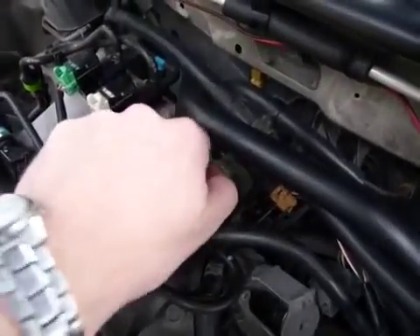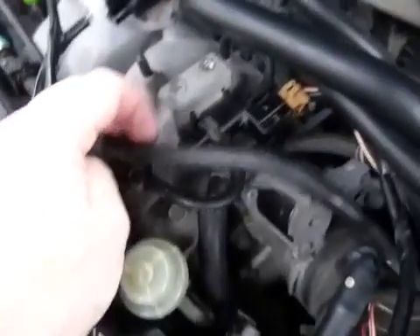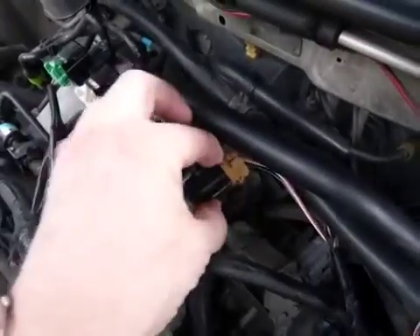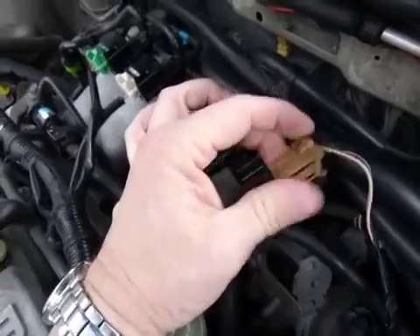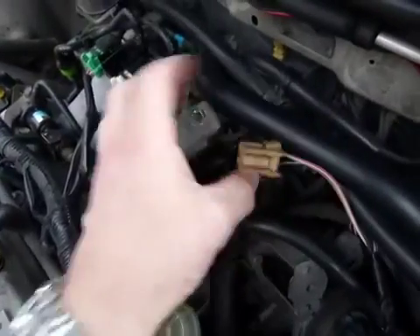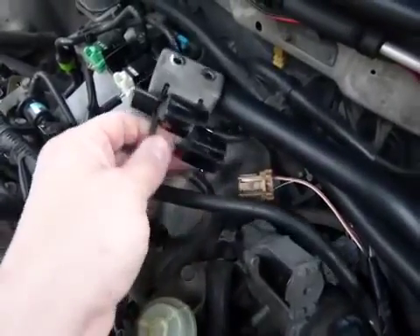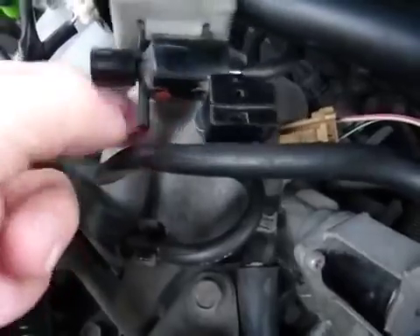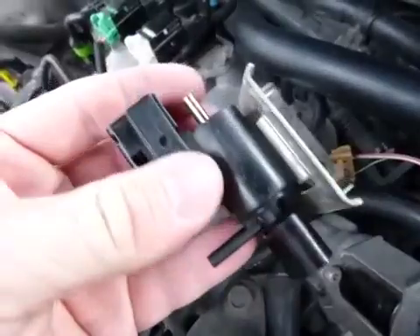I already have cleaned these vacuum hoses around and have partially removed this plug, so you're gonna need to put your hands on it a little better than this because I have just pre-loosened everything. That's how it comes apart. Make sure when you take these hoses off, don't break off these plastic little ends. It's gonna be coming apart with a little more grunt than this.